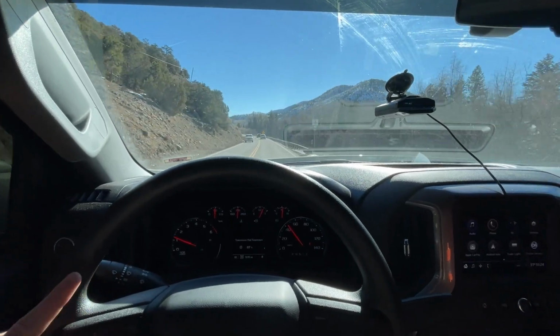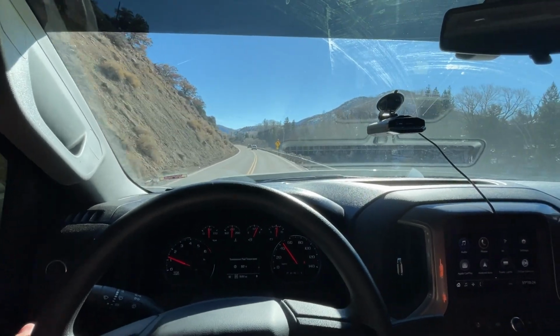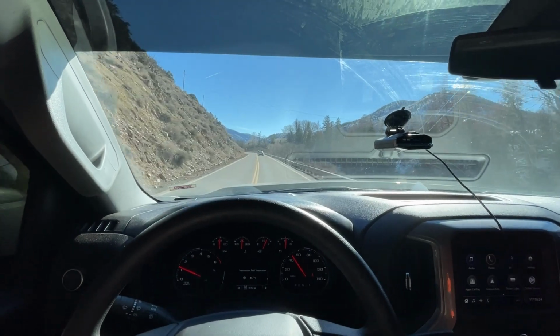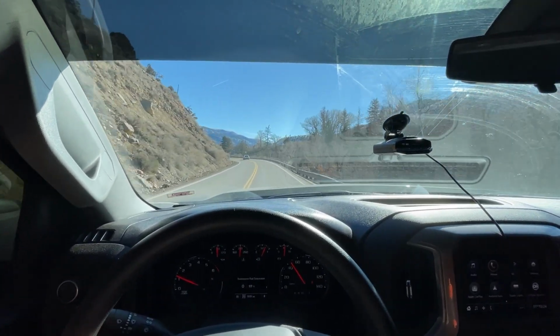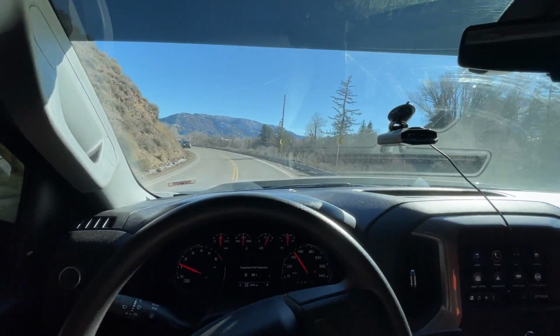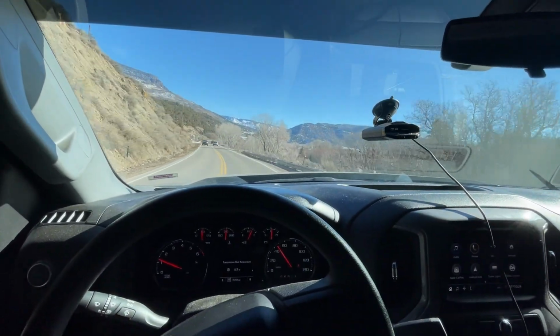Other first impressions: it absolutely freaked me out when my truck wouldn't start and all the lights came on, but that is my problem for not clicking them in all the way. So if your truck does that, check your connections, and if it still does, just unplug it and plug your factory harness back in. That'll fix it all. And yeah, make sure it's not in a spot where it'll get kicked. Otherwise, there's a chance that your truck will freak out.